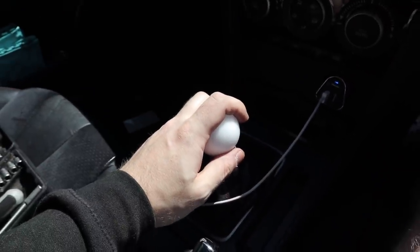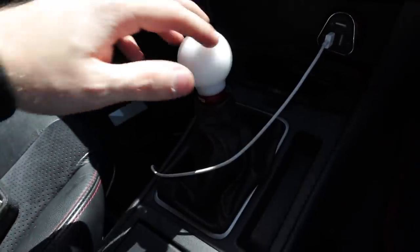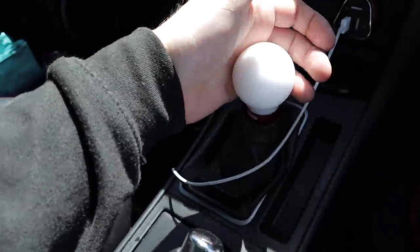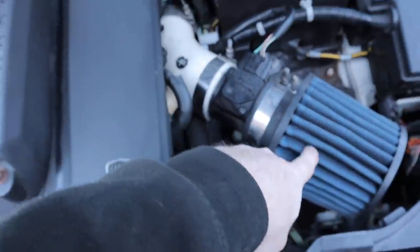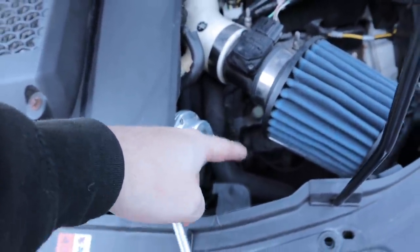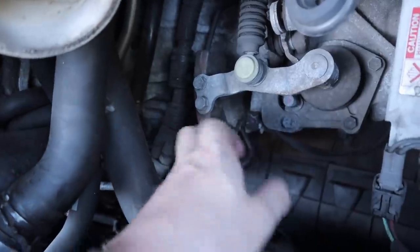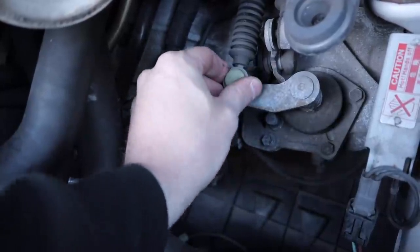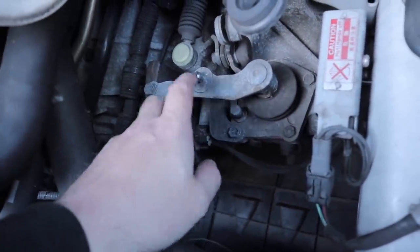Just for the camera I'm going to get a little before and after. Let's crack on. First things first, I'm going to unbolt this bolt here and take the cone off — that gives us access to the actual shift plate. This is the OEM shift plate — this is what we're going to be replacing. We're going to take the actual linkage off and just replace it all.